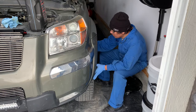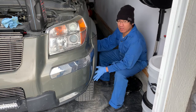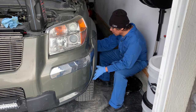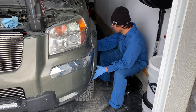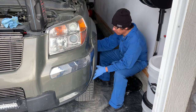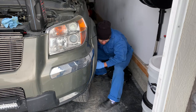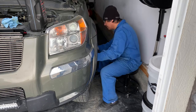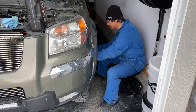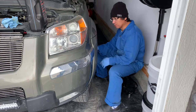Another issue I'm currently trying to troubleshoot — I believe I probably have a sway bar end link that needs to be changed. I've got some clunking noise mainly on small bumps. I don't see it on high speed or bigger bumps, it's mainly just the small little bumps. The sway bar end links definitely seem loose. It could be the main issue, or it could just be the sway bar itself and all the bushings — maybe it requires a new bushing. Something we could definitely look into.